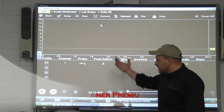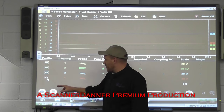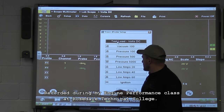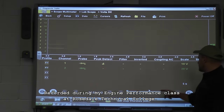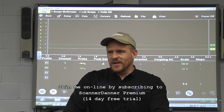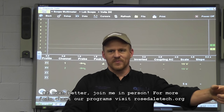I can switch channels when I'm in here. I want a two-channel setup - you can see my other channels are right here, I can turn all those on. It's always a four-channel scope, it's just the presets going into it. I want my second channel, but it's defaulted to KV - that's ignition. I don't want an ignition probe, I want volts DC. This is a five-volt pull-down design, so I'm going to drop it down to 10 volts so my square waves are bigger on the screen.